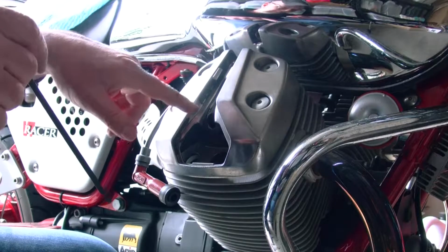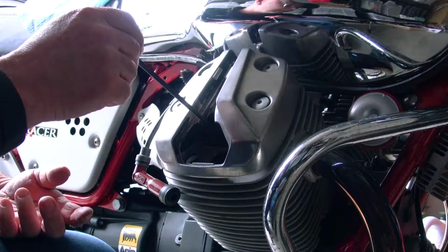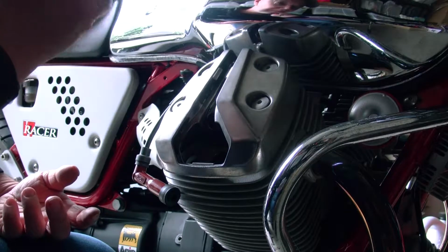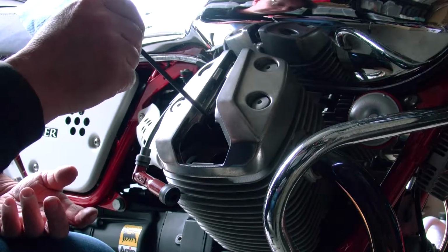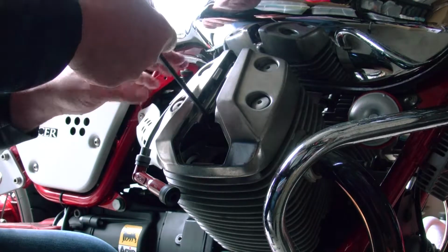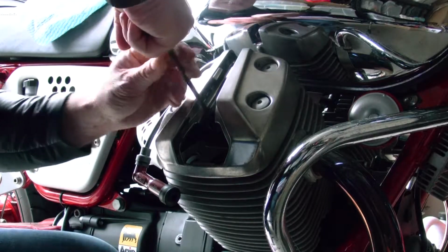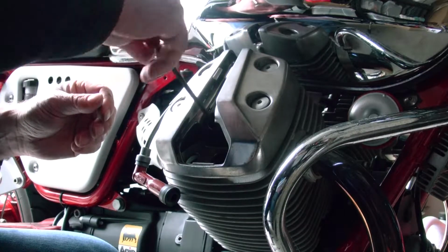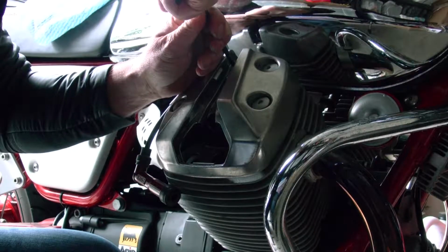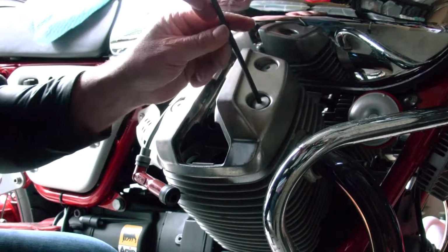Okay, and the thing is, there's actually a couple more on this model, the V7, the 2012 and up in Australia, or 2013 model and up in the US, single throttle body model. It has these extra bolts down here, and I didn't know this when I first tried this, and I was wondering why this wasn't coming off, but they're hidden down here. So these, oh god, this one's tight. What a disaster if you strip the thread on one of these. These don't need to be this tight. Okay, alright, so let's get these off.